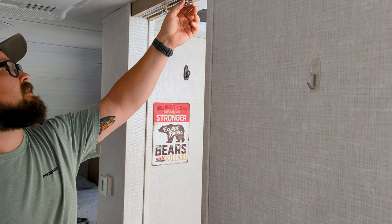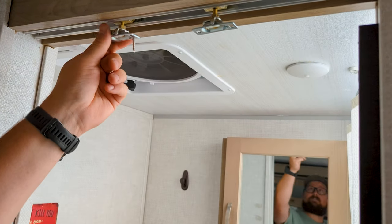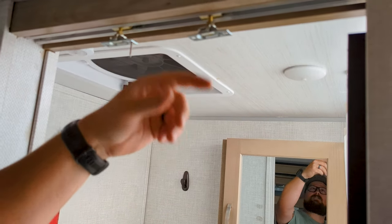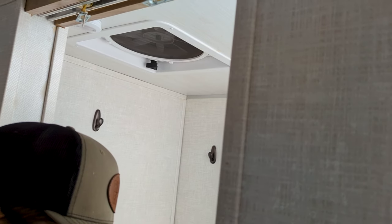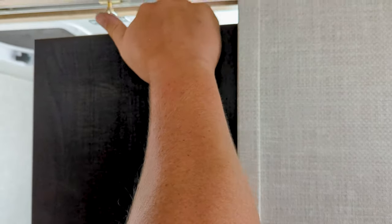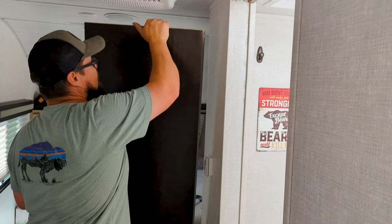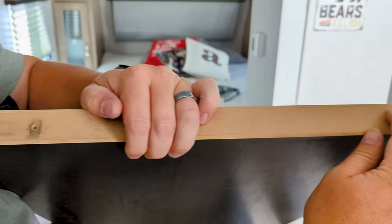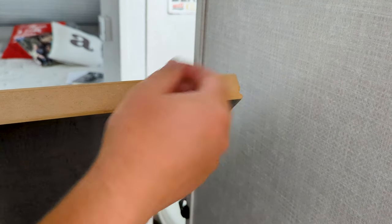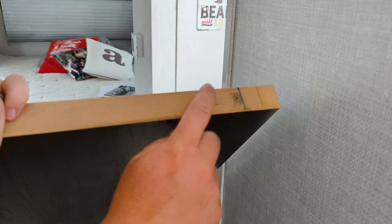On our trip back home, it fell off of these little hinges up here on this C-channel. These are rollers on the C-channel. You can see it's got a couple of screws left over, but when we pull this door out — we're just going to pull this out carefully and bring it out at an angle. You can see on the top right where those screws just pulled out. This is just like a fiberboard, so they just pulled straight out. We're going to go back in with some heavier, larger screws and see if that holds it up.